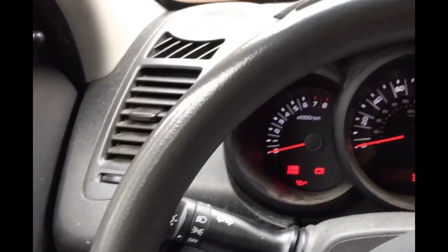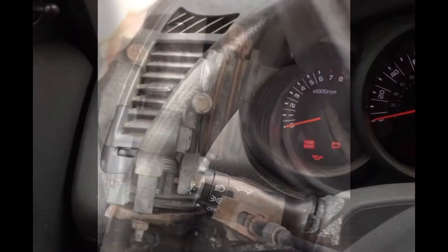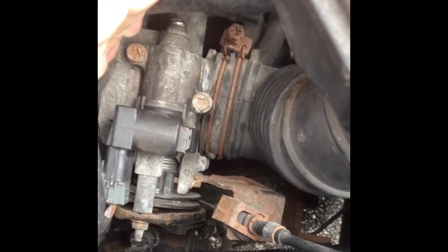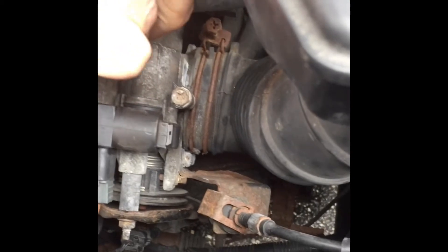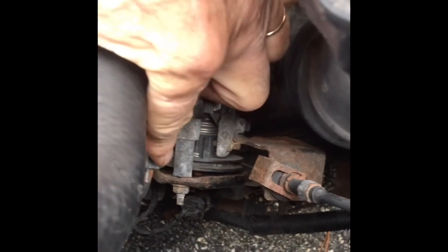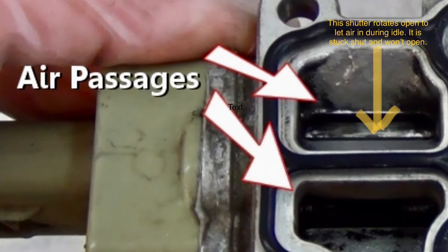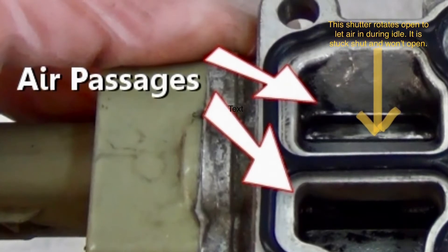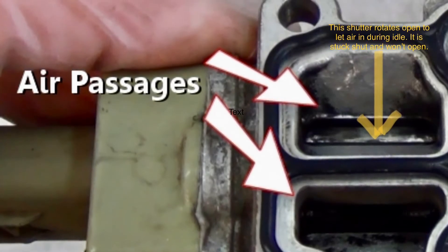You can see it slowed down when my foot was off the gas and it stalled out. Right there is the idle air flow controller valve. There are two screws, one there and one there. It comes right off, and then there's an electrical connector right there that comes off easily also. If it's not obvious where the idle control valve is, follow the air intake manifold down to where it connects to the throttle body — right there on the throttle body the idle control valve will be attached.